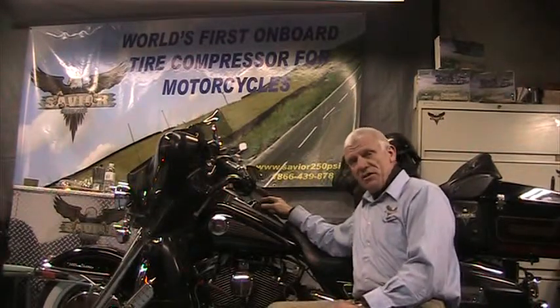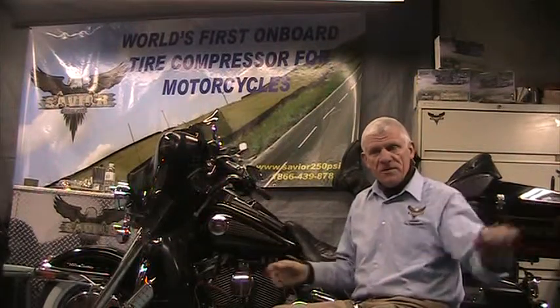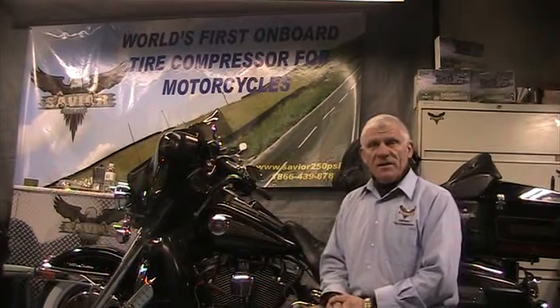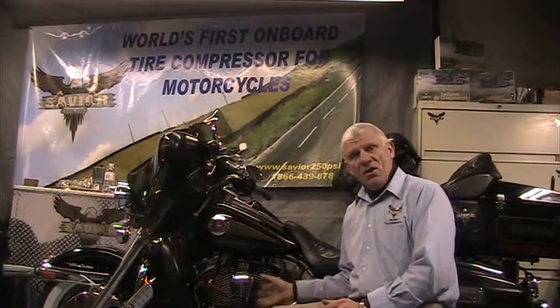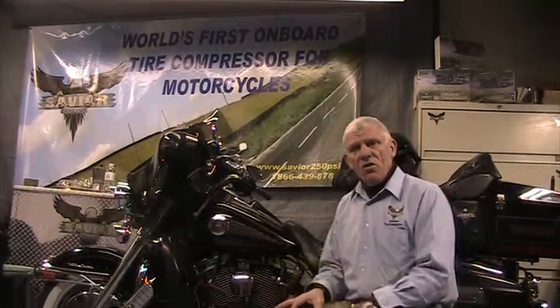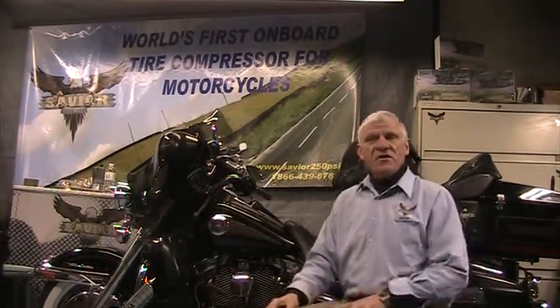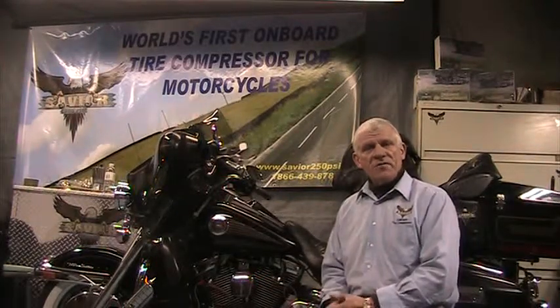This is a great opportunity to drain all the oil out of your engine, primary and the transmission, and replace the oil with a lighter oil. In this case, I put 5W20 oil because it's still very cold out there. And by the time I get to 4000 kilometers, I'll be able to put the regular 20W50 oil.